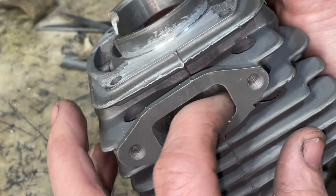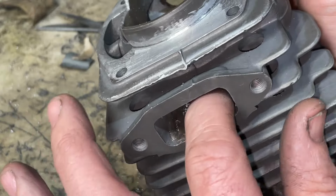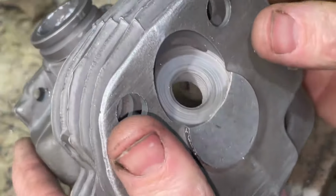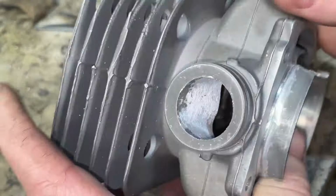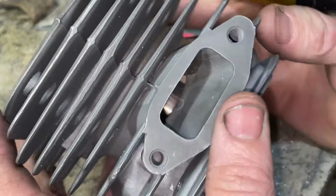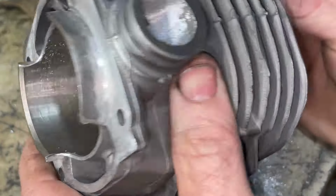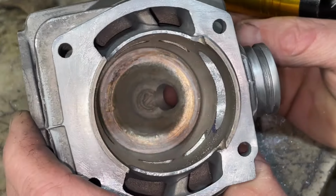Yeah, I'm getting some stuff on my putty there, but it's already gotten pretty hard there, and that should all just grind right out of there. But it's gonna be interesting, guys. 100% this cheapo cylinder was definitely just too much duration, too high of an exhaust roof. It was sitting well over 160, so I had to do something about that to make this thing what I want. So we'll see. It could be an epic failure, or it could be an epic success. We shall see.